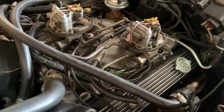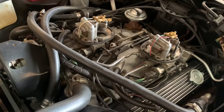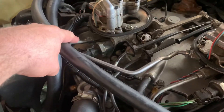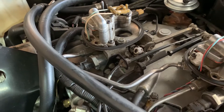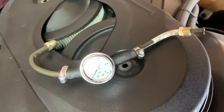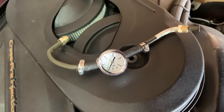You're going to want to measure your fuel pressure with the engine running. How the fuel pressure is measured on a Crossfire motor is between the two throttle bodies on this crossover line right here. This is the outlet of the slave throttle body going into the inlet of the master throttle body. What I did was I made a — it looks like garbage but it works — a small bent-up piece of 3/8 tubing and a cheap $10, 15-pound fuel pressure gauge.